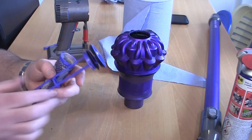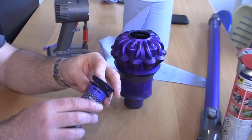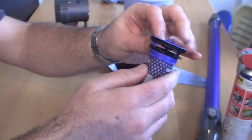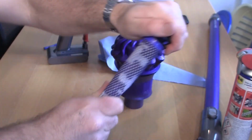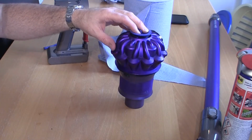So once your filter's completely dry, or you've bought a new one using the link in the description below this video, you just poke this back up here. You can see how they go. There's a little notch on here, you just have to push it up past there so they all click into place. You can see everything, just give it a nice pull down, make sure everything's nice and secure, and we can just slide a nice clean filter, or our new filter, into this cyclone.